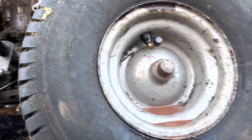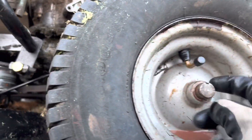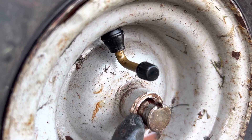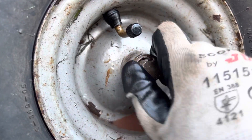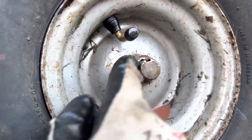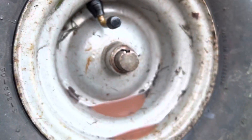I failed to get this off. I nearly got it off but it was stuck on this last bit, past where the circlip goes. I think what I need to do is get some sandpaper and basically polish this to make it smoother. I managed to get this back on - just put a 19mm socket on and gave it a whack, so that's back on.